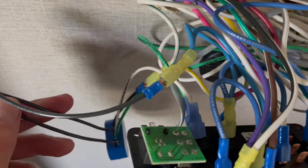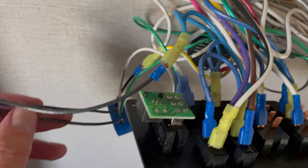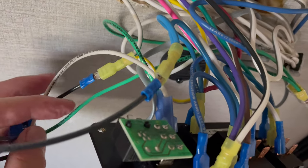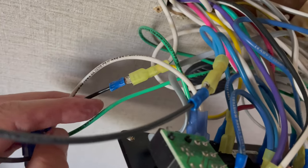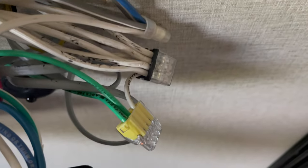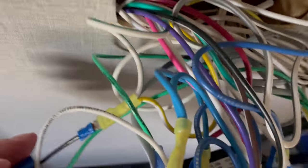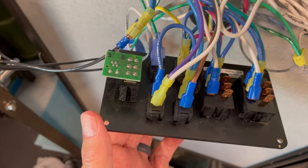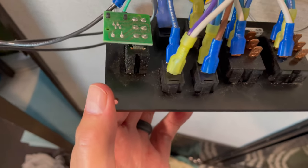The 12-volt positive connections, the N plus and the I connectors on the Shelly PM1, are connected together with the blue wire we identified earlier as the power source. The O connection is going to the wire that was connected to the bottom of the light switch. The L minus connection goes to the 12-volt negative bundle, along with the wire connecting to the bottom of the switch, and the SW connector is going to the top pole of the light switch. Test the light switch to ensure it works still. If it doesn't work with the physical switch at this point, it won't work with the Shelly relay.